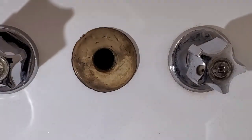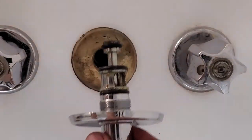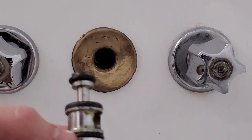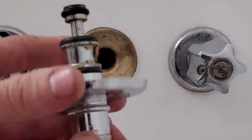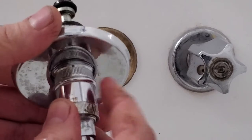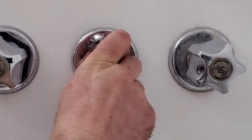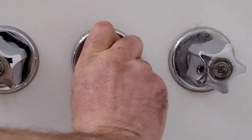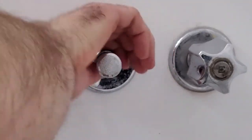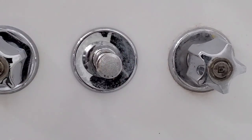So we're going to take our diverter valve and put it back in. You want to make sure this is on — it's gonna slide down into place. You got your third o-ring on there, and this piece here comes off; not all of them are the same. It slides down onto this little shelf here, this little edge. Go ahead and slide that back in, get it nice and straight, and start screwing it back in.